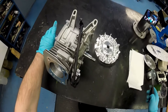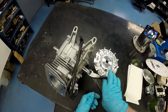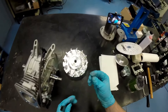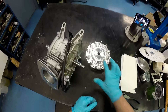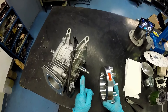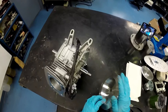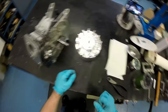The easiest way I've found to get these keys out is with a standard set of everyday side cutters — you can get in there, it grips the key very well and just pry it right up. Set the key somewhere where you can find it because you're going to need it later. Lapping the flywheel is nothing more than using some type of compound on the tapers to grind away any imperfections that may be in the machining process between the two tapers, so they mate up nicely and properly and stay torqued like they need to.